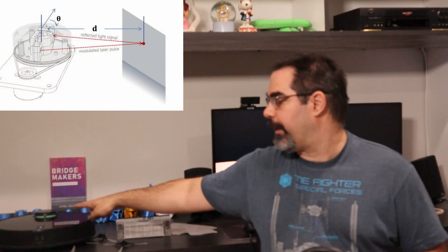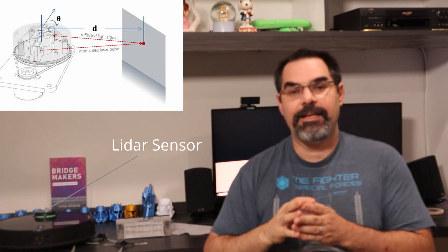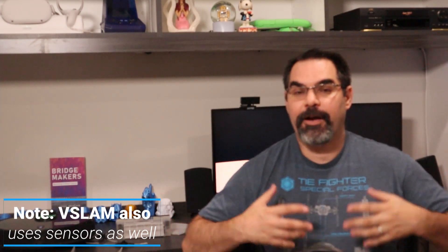Now let's talk about the technologies — LiDAR and SLAM. LiDAR is the thing spinning on top: it shoots light out, measures how long it takes to come back, and figures out the distance between objects. Because it's spinning, it gets a sense of everything around it. The competing technology is V-SLAM — visual SLAM — which is a camera pointing at the ceiling to map the robot's position. The problem with V-SLAM is you need the lights on for it to work well. With LiDAR, using laser or infrared light, you can operate in total darkness. Since I like having it sweep while I'm asleep, it's nice not to need my lights on — that's one of the key benefits of LiDAR.